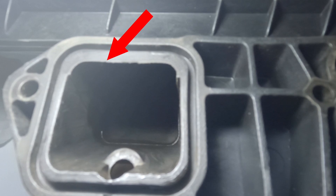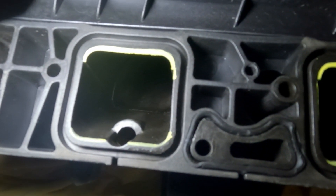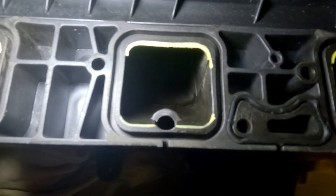If you take a close look at the top of the port here, you can usually see the impression of where the cylinder head mates up to the intake manifold. There's some extra material there that can be removed, as long as we don't make the intake port larger than the port in the head. We can also remove quite a bit off of that injector boss as well. I've outlined the material I'm going to remove with some yellow paint just to serve as a guide.